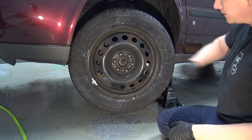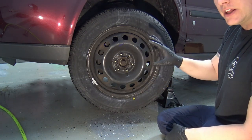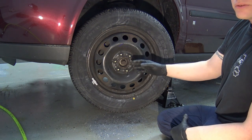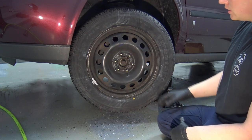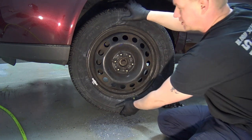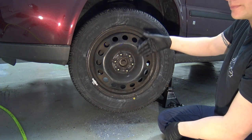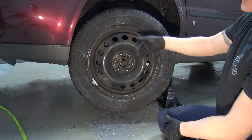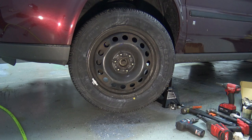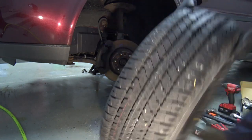The wheel may fall right off, or you may have to hit it a little bit. Before unsticking it, one thing to show you is how to check for a bad wheel bearing — and ball joints too. Grab from the 12 o'clock and 6 o'clock position and push back and forth. There should be no movement. On this one it's slight but it's definitely there — on the road test it's just starting to make noise. That's a good check. To break the rust bond you can rock the wheel and it will come free.